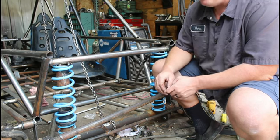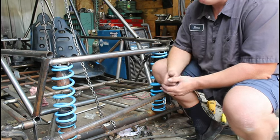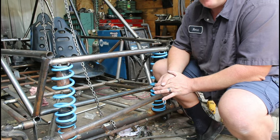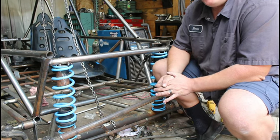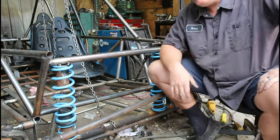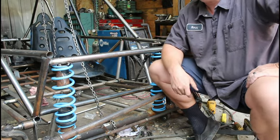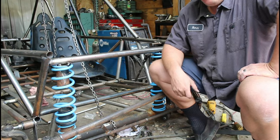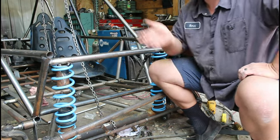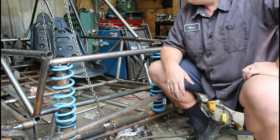Yeah, with the link pin long travel suspension, your link pins just go to hell in a handbasket the first ride, and then there's always just this little broop, broop, broop when you're riding, and you don't really notice it in the sand because the sand's generally smooth, but when you're out in the desert you notice it because you'll go around a turn and your tire just decides it wants to look sideways at you.